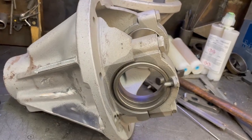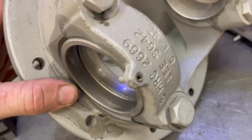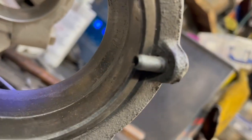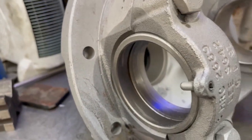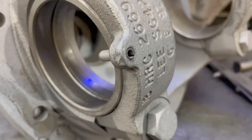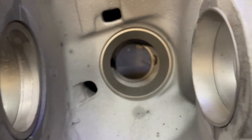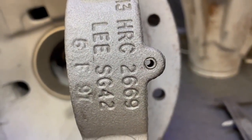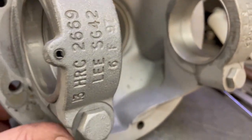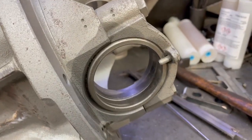The flat cap casing is called the flat cap because it has a flat cap. It's held in with a very silly little roll pin which is hollow — about 3mm — which is absolutely no use at all. We've seen lots of these break off. As you can see, that one's not even quite central.